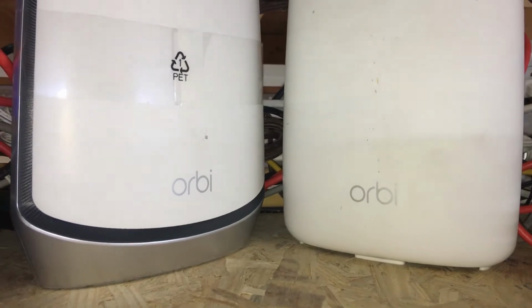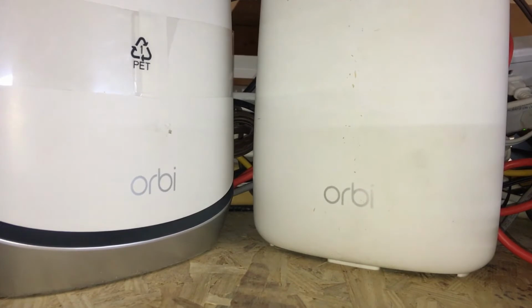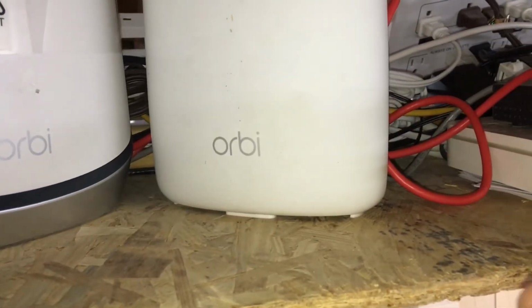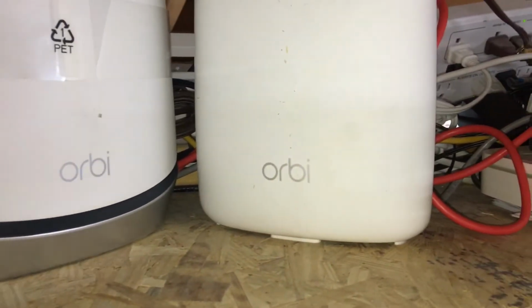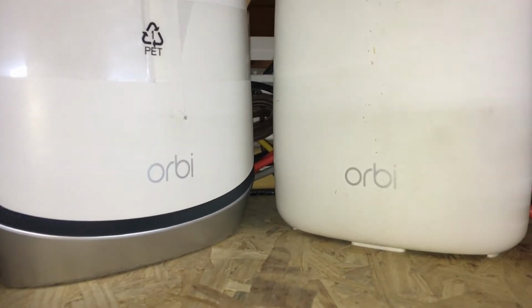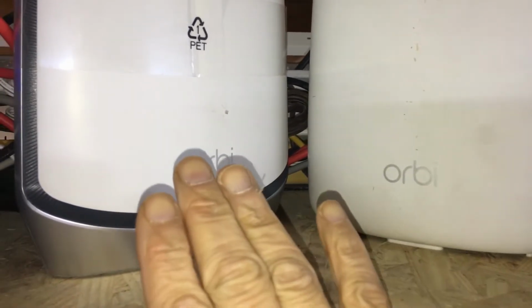they came up. So what I'm doing right now is actually using an additional 4 Wi-Fi 5 satellites, just the satellites. And I'm making a backhaul physical Ethernet connection. So this is physically connected to this, and my other satellites are connected to either this or this. So I was able to extend these satellite systems, the Wi-Fi 5 satellites, by making a physical connection to this.